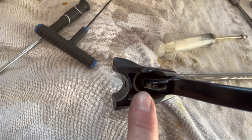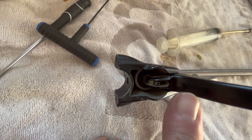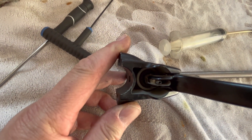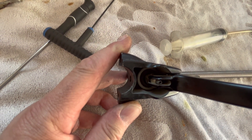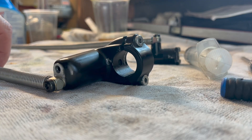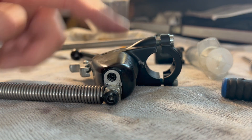...that set screw I just explained — make sure that's out as far as you can get it without letting it come all the way out. So you want to loosen the pressure completely in the line to fill it. We are going to bleed the hydraulic clutch from the master cylinder, which is the handle.